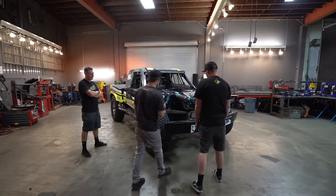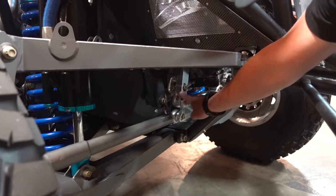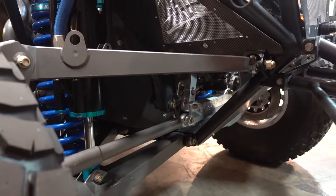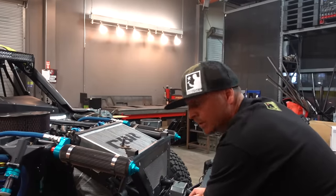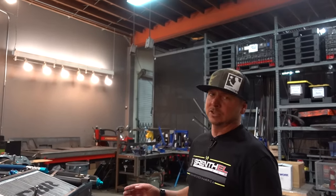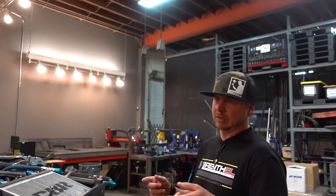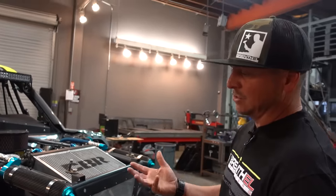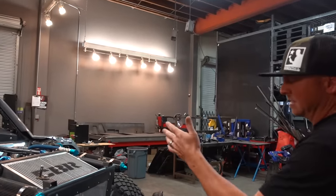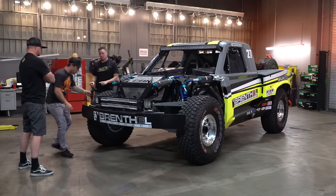Steering is a big part of the suspension integrated into the Gen 3. You can see all these billet plates with Zerk fittings that make it greasable from the outside. Usually you use a steering rack, and it's much easier to build, but no matter what geometry you do trying to get bump steer out, you cannot eliminate bump steer in a turn with a rack that goes straight. You need something that moves in an arc — and that's what we call swing set steering. It swings up and down instead of just going back and forth.